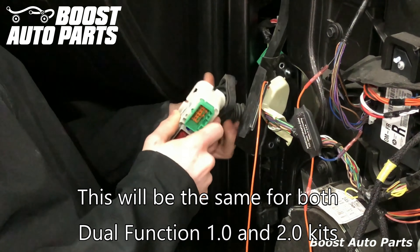Make sure all your orange wire is pulled through. Take your hand and slowly close the door — not to pinch your hand — but it'll give you the room you need. Slide it up and you'll hear it snap in. Make sure the boot doesn't get twisted around, then put it back up and reinstall the two T15 bolts. Slide the plastic retainer back onto the metal clip.